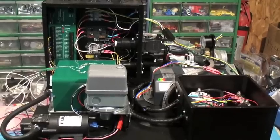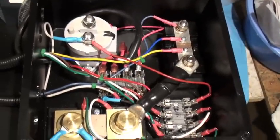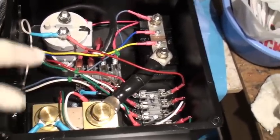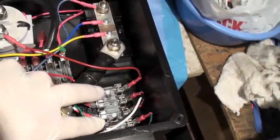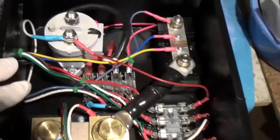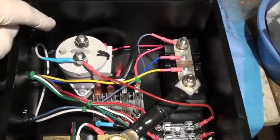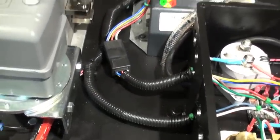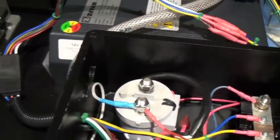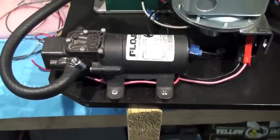The electronic boards are here, all the fuses and relays. In this first plastic box you can see two shunts — this is the shunt that goes to the ammeter, and this is the shunt that goes to the Expert Pro. There are fuses in here so that my ammeter and voltmeter are fused. I've got fuses here for the main contactor, fuses for the DC to DC converter. This is the main contactor. I've got some of these things in wiring looms already, and I have it all set up so I can take each component off individually — they will all separate so I can remove this box or whatever component I'm working on.